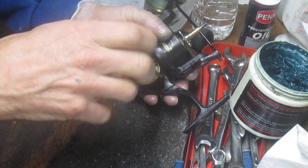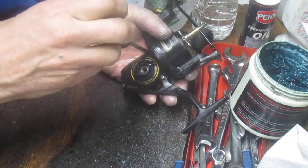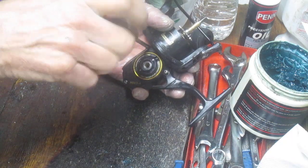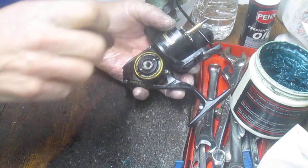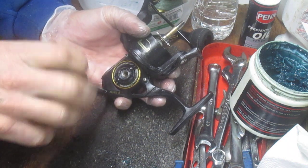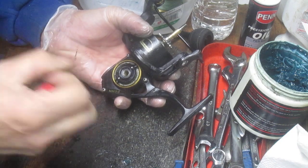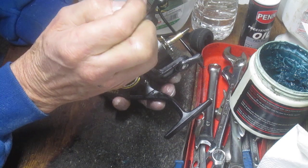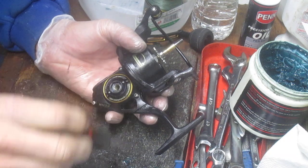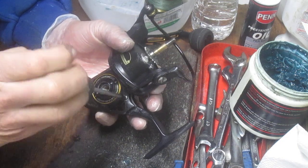So we're going to pull that shim out and see if it makes a difference. Sometimes that shim is there because there's extra play in the teeth, and sometimes it's not needed. In this case I don't believe it's needed. This is a lot of times trial and error. It's like the guy who brings the car into a mechanic and tries to replicate the noise, which of course never sounds like what the thing actually does. The mechanic's got to go with his best guess and see where it takes him. I think that shim might be having an effect, so we'll see.